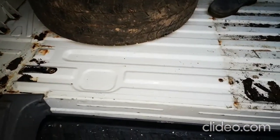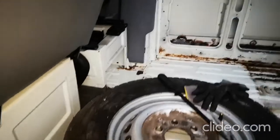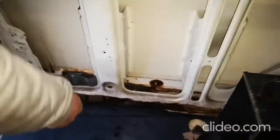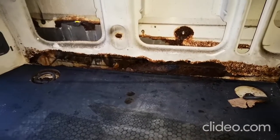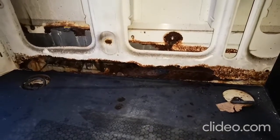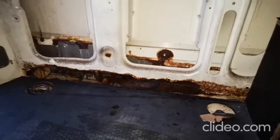We're starting to clean the floor up and it's coming up quite well - a little bit of Kurust on there, some primer and a bit of white paint will sort that out nicely. We've got some pretty bad rot at the back of the van - this whole panel has rotted out. It's pointless trying to patch over it because it will just keep rotting, so we're going to have to cut out all the rot and weld some new panels in to repair it. But it's an eleven-year-old van, so you've got to expect some issues here and there.